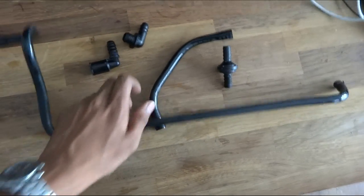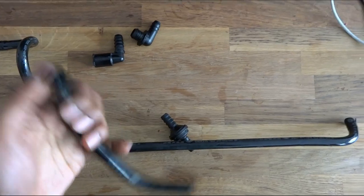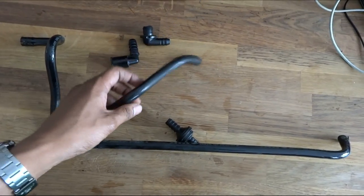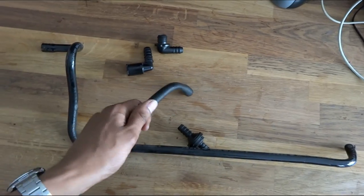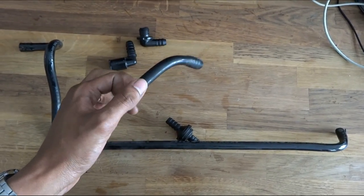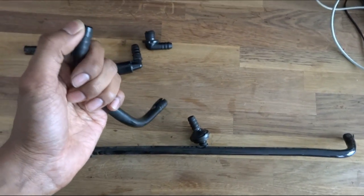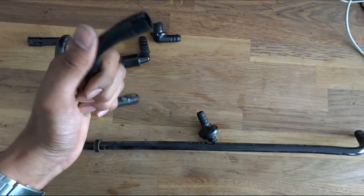The solid hose itself is really not in bad shape — it's not brittle or anything; it's literally just the ends where it's stretched that split. When I turned the engine back on for the first time after the repair, the RPMs would go up and then it would stall out. When I pressed the accelerator I could keep it at around two thousand RPMs, but as soon as I let go it would stall out. I'm pretty sure it's because the ECU adapted to the vacuum leak being constantly there, so it was still in that mindset and was causing the engine to stall.